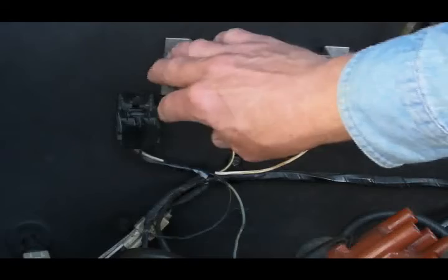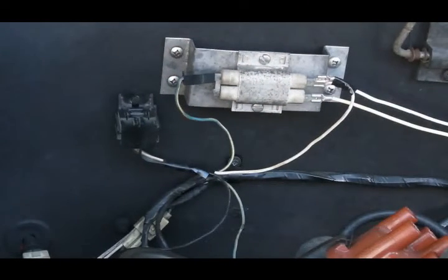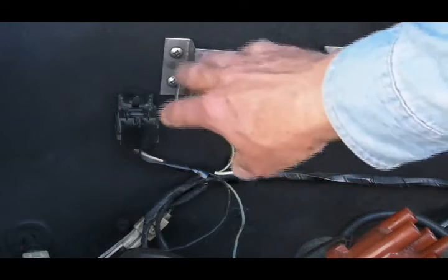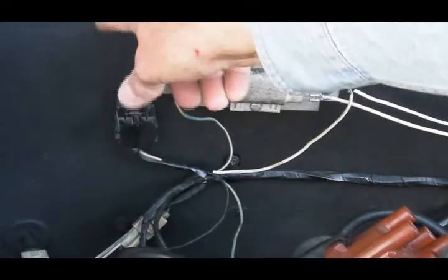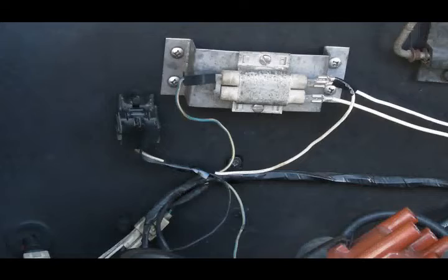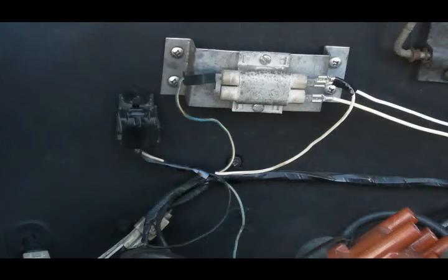The black wire just goes up to a bundle of ground wires attached to the bracketry that runs across the back of the engine compartment. There's a bundle of ground wires attached to one of those bolts on the bracket - there's the engine compartment light switch and a couple of other things grounded to that bolt. Then there's one wire that goes from that bundle over to either the intake manifold or the valve cover, and that's how the bundle then gets grounded to the engine block and through the engine block ground to the chassis ground. So that is how the starter bypass relay is wired in and how it operates.